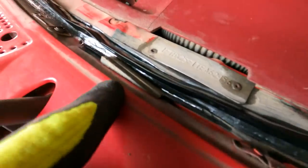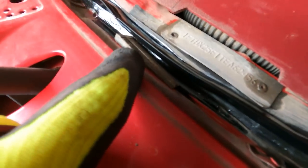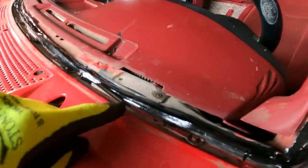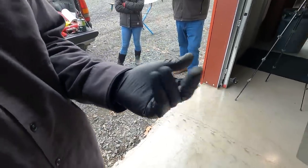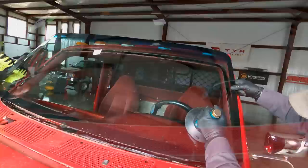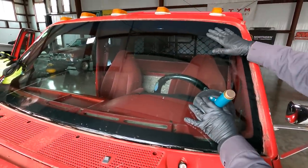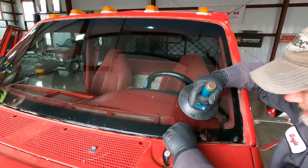So we've got our glue in place. This is called a set block, guys — it sets the windshield up off of the metal and off these brackets. Now this one is missing a piece; Ford used to make a set block that was adjustable, but when the windshield was replaced by the last person, that set block got damaged or destroyed. These are handmade, handcrafted — custom-made set blocks. Here's a point where you really want somebody to talk to you — always. We're going to set it on the block, gently place it, and if we need to raise it, we can add one of these custom-made blocks to wedge it up just a little bit as needed.